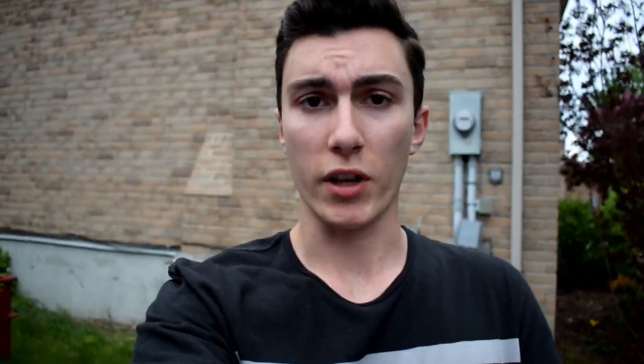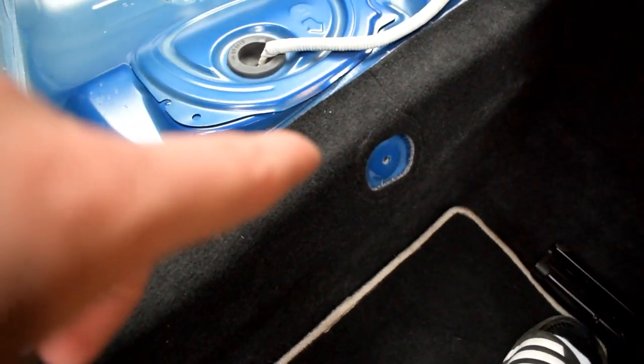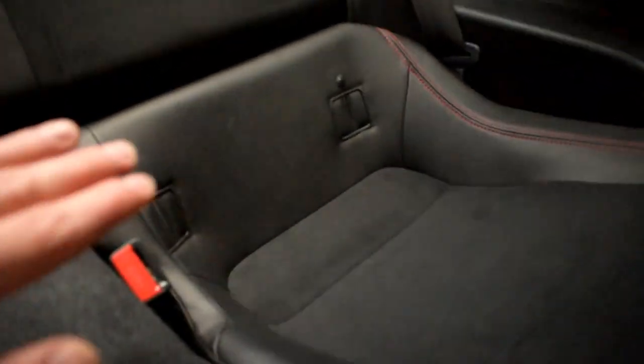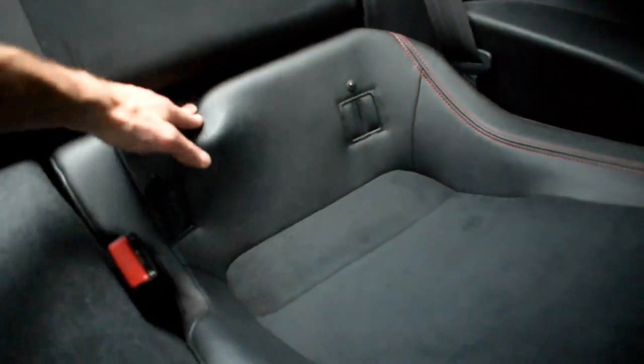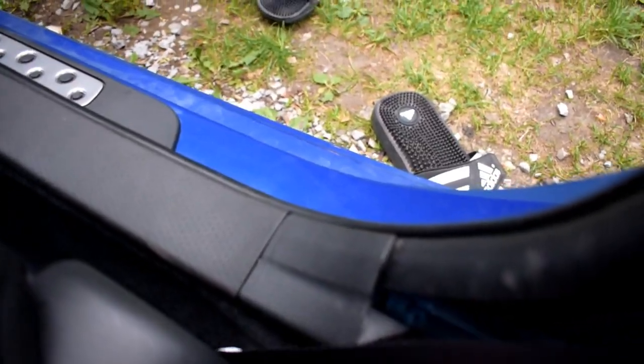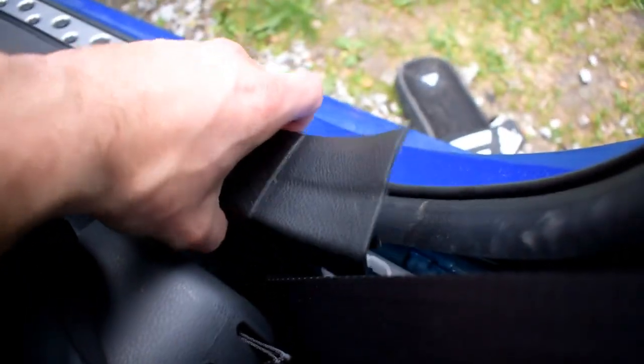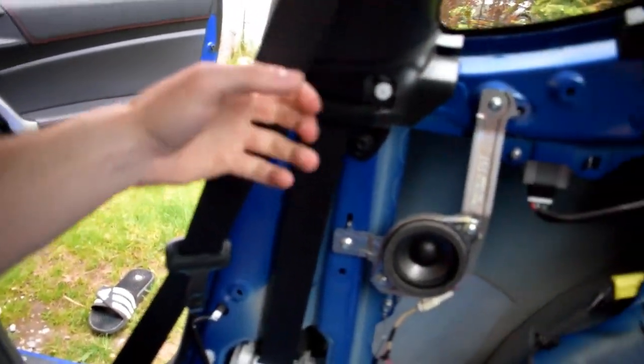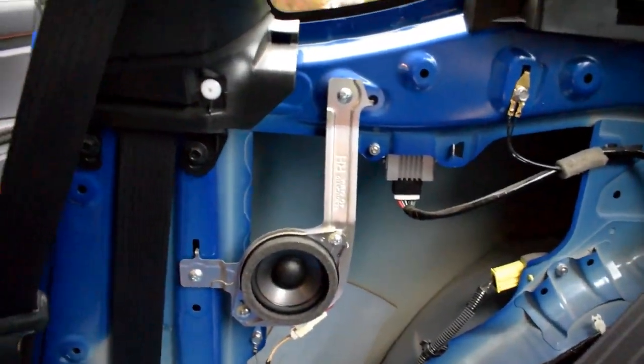So then you have to take out the back seat on both sides, which is actually very easy. You just take out the 10 millimeter bolt which would have been right there, and then there's a tab in the back — you just press down on the top of the seat really hard and it just slides out. Then once you have the seat out you're going to take out the little side panel and lift up this little trim piece just by pulling on it. You can use trim tools but I don't. Just pull on it and start pulling the panel back until it all pops out and slide it out.